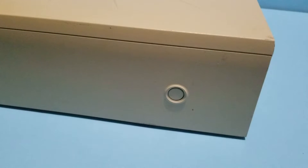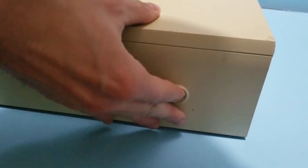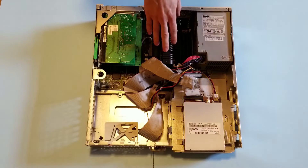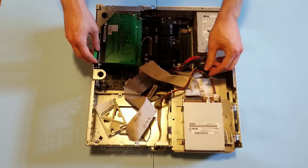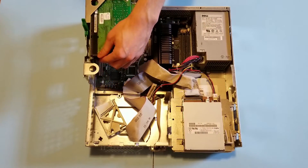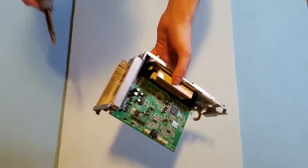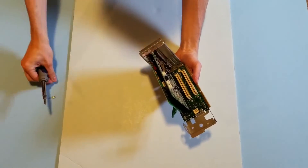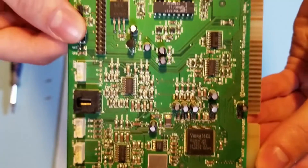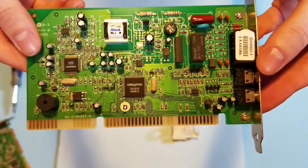What I really like about these machines is how easy they are to open - just hold down two buttons on the sides and the lid slides right off. Here's that classic vertical Pentium II processor with a heatsink. No hard drive as described. Let's pop out this expansion unit which already has some cards in it. Just lift a small lever and the whole thing comes out - makes for a very easy installation. This is a Creative Vibra sound card. Currently I don't have a use for it as I had a different card in mind. And this looks like a Creative Modem Blaster - cool, never had one before.